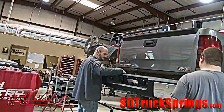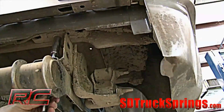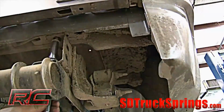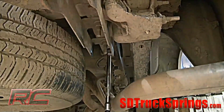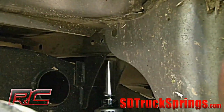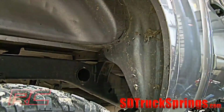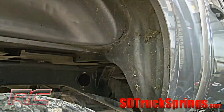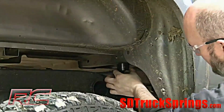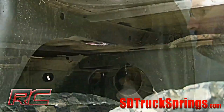Next, remove the bumper and set it aside. Loosen the 6 bed bolts, but only remove one side at a time. With a jack stand or hydraulic jack and wood block, raise the passenger side slowly. Raise the bed up enough to install body spacers. Install 4 body spacers per side and add Loctite on all the supplied bolts and washers.